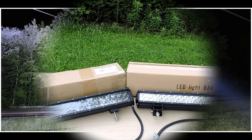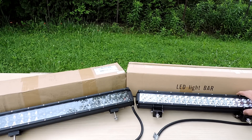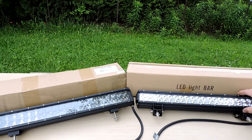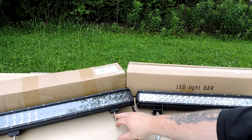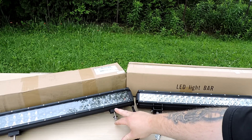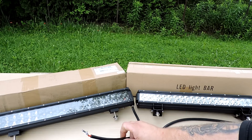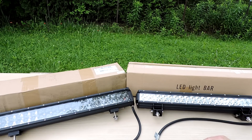We've taken a look at both light bars after dark and they both work really well. Which one's better? It all comes down to what you're going to use it for. If you're trail riding in the woods on a four-wheeler or a Razor, the Cree gives you a really good flood effect and lights up the whole area very well. But if you want to shoot a really bright beam a long distance, by all means the Osram is the way to go. Also, the Osram uses more power, so if you have a limited charging system like on a four-wheeler, it's going to put more strain on it. They're both really good lights — which one's better just depends on what you're going to be using them for.